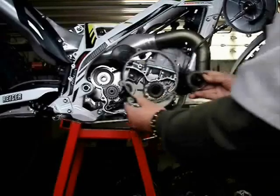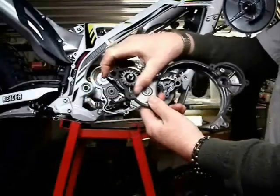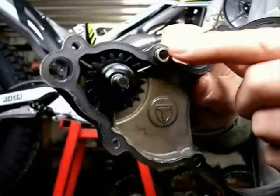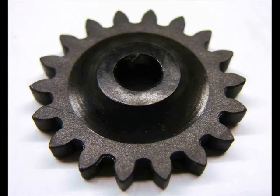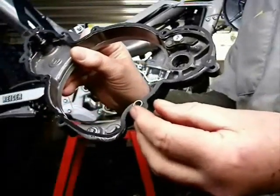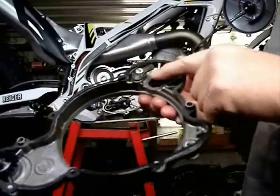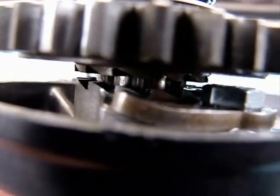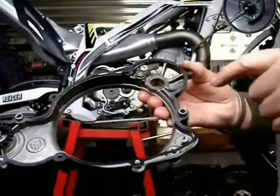When you're looking at the side of the engine and thinking about reinstalling the clutch cover, remember that the water pump gear, which is a composite resin, must also mesh with the gear on the front of the engine — the primary driven gear. When putting the clutch cover back on, you have to manipulate the kickstart spring preload, but at the same time make sure you rotate the water pump gear so it falls in place. The ramp and thumb separate the two kickstart gears when the pedal is retracted to its park position, because that thumb falls behind the little ramp.